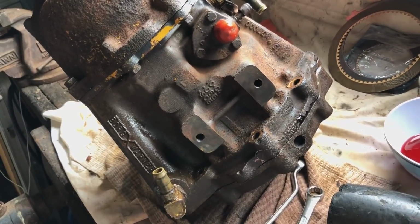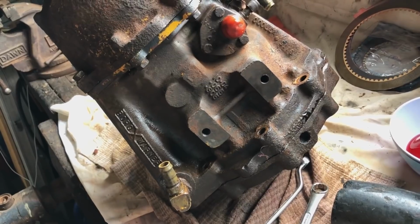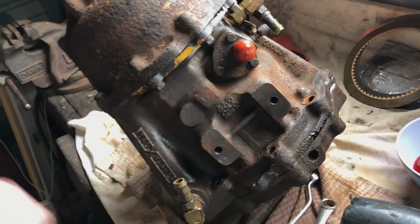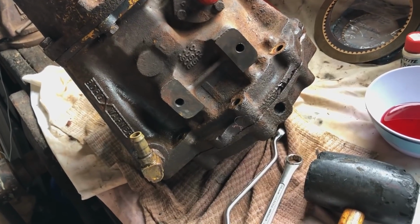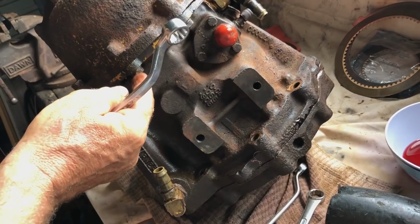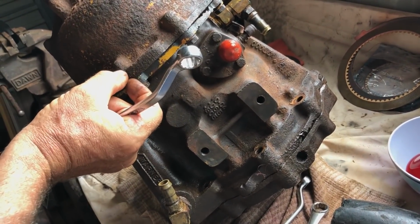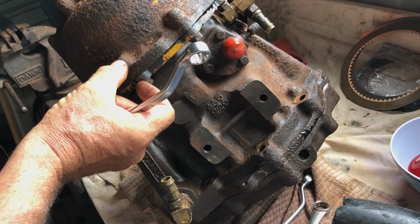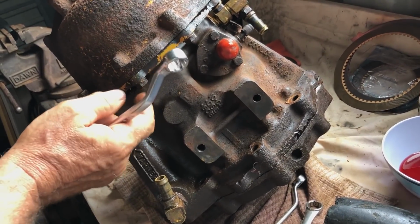So it's nothing to do with strength or anything? No. And jiggle and vibration and the sound waves that jiggle some out and not others. No, well, bolt tension has nothing to do with the thread or the surface area or anything like that. It's actually the stretch in the bolt, which is how you set your bolt tension.